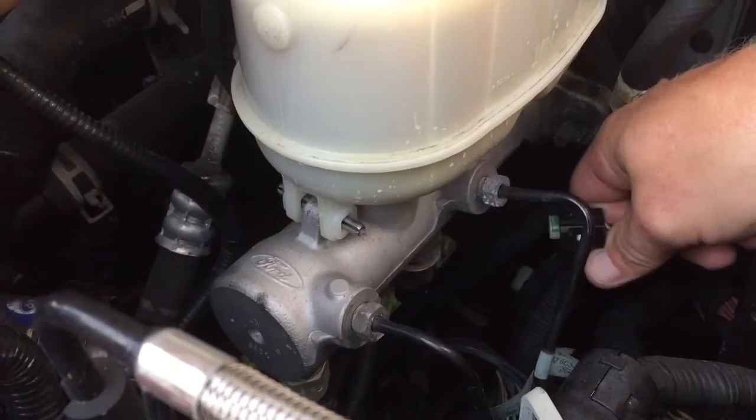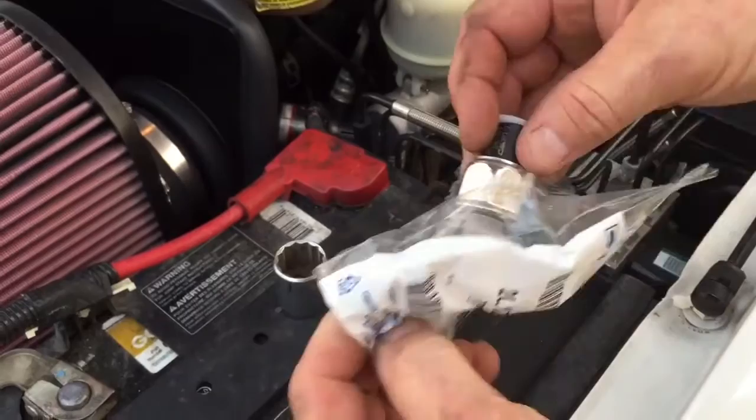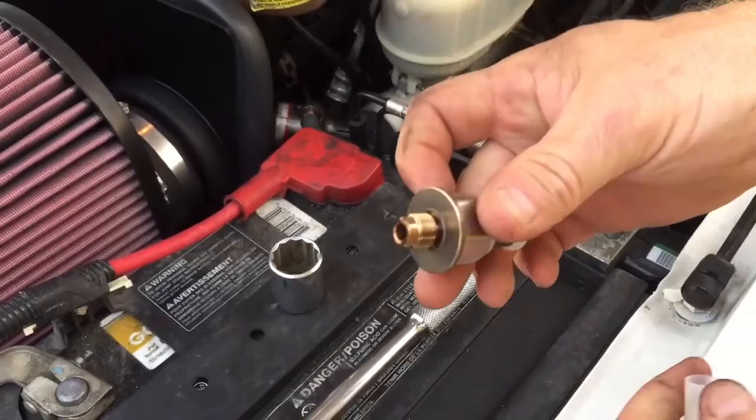It's just a little squeeze and then pull down on the plug itself. Then I'm going to put a rag underneath because there will be a few drips of brake fluid, and that will just keep it a lot cleaner in my engine bay. Here's my new transducer. I want to go ahead and take the caps off and get it ready — it's a little bit less dripping if you have it ready to go.